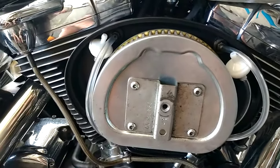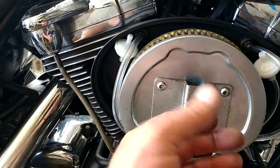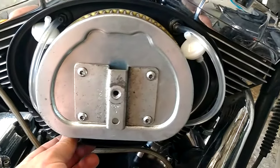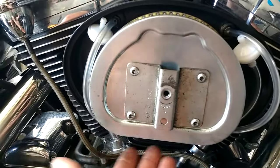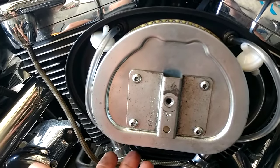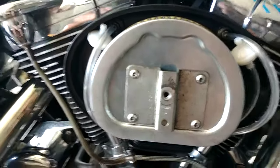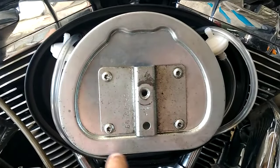With this method, you want to open just one screw on the bike, open this up, and check for accumulated water and oil vapor on the bottom side in the low section of these lines. It's a trap, basically — you're just trapping the oil vapors below your air cleaner.